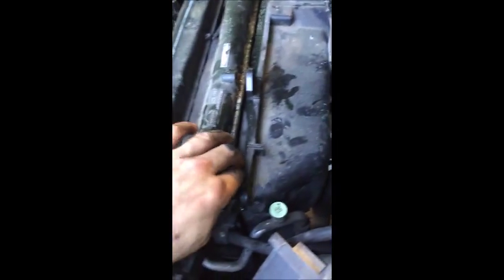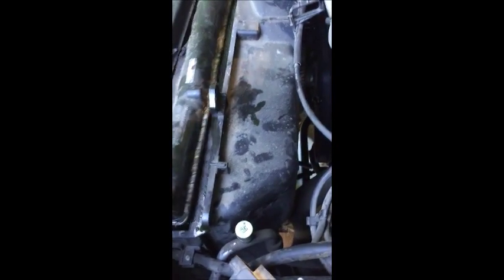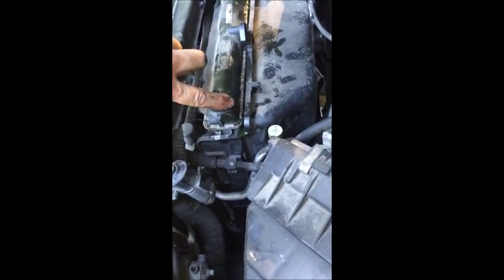So far it's the easiest radiator in the world — the thing is already out. What I'm going to do is go under and disconnect the two hoses for the transmission cooler and the lower hose for the engine. On the top we're all set. You can see it's already moving and we only separated the two brackets and two 10mm bolts on the side here for this shroud.